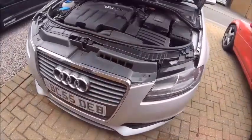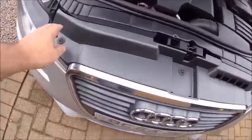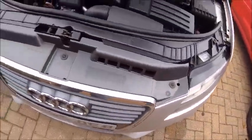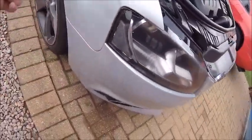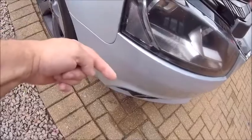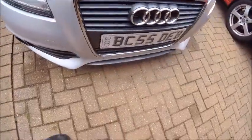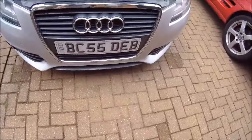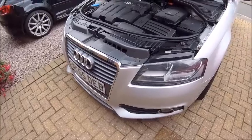I'm not going to go into too much detail about removing the bumper — you've seen me do it before. Basically one, two, three screws on the top, some hidden behind here in the arches, one that goes directly into the bumper from the back, and a couple of hold brackets. One's at the bottom off the skid pan, and then it should drop off. Let's just get on with it.